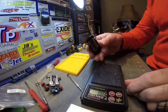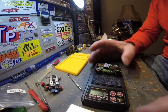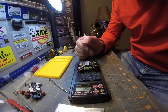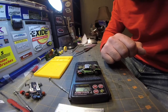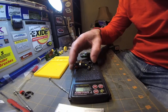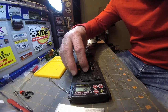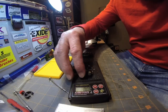regular car. So if you look at this, this is the other Fray car that I've been racing. Matter of fact, this is the car that won the Fray Championship here. I took that class, so a very good build that we did with this car. So as you can see, that's a 2.5 on that side and a 2.4 on that side. And I don't have the pickup shoe guide pin in there. But as you can see, we're like a 2.1 on that side.